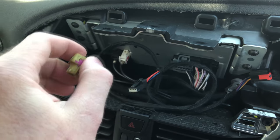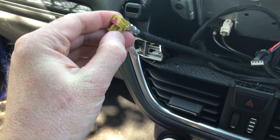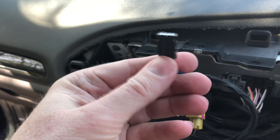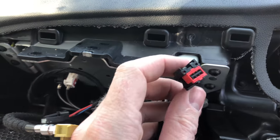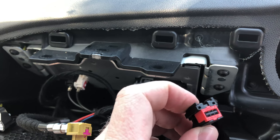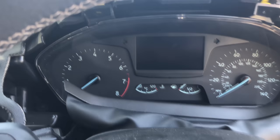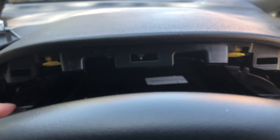Unplug the HSD cable. There's a clip on the back — get a screwdriver in there and hit the release clip. Then there's what I assume is LIN and power for the buttons on the screen, and a small connector for the start-stop button which also needs to be unclipped. Removing the instrument cluster: there are two Torx screws that need to come out, then put your fingers here and push the screen down — it unclips.